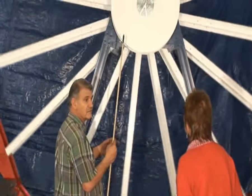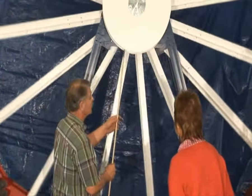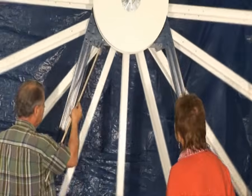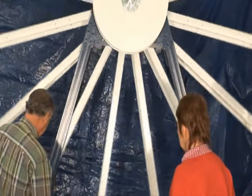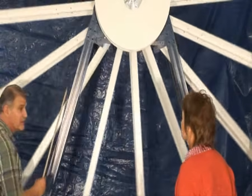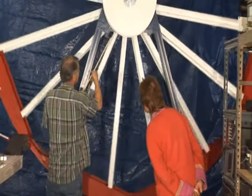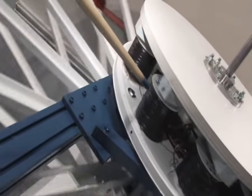to push back. So what we want to have happen, if this is what was a north pole, we want that to flip to a south pole. So we have to give that magnet a set of instructions to do it. And the spike, this little flash with the little timing wheel up there, is a set of instructions when this little pie-shaped magnet comes across the pole.